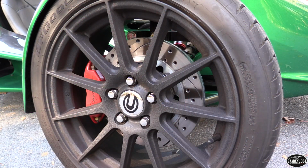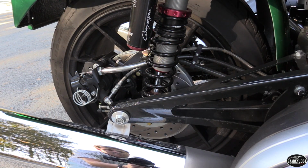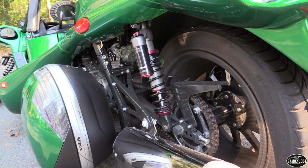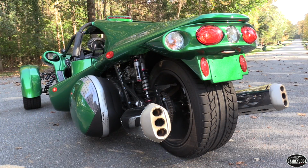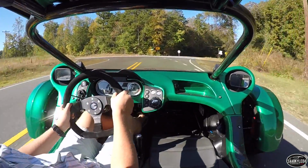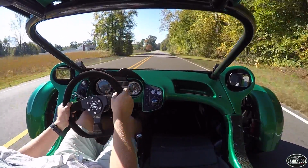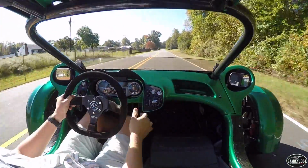The last major hardware upgrade for the performance model includes an upgraded braking system with internally ventilated, slotted and cross-drilled disc brakes and red calipers at each corner. The brakes aren't powered and there's no ABS or any form of electronic stability control. Stopping power is perfectly proportional to the pressure you apply. Like the steering, the brakes are communicative and easy to operate. It doesn't take much effort to stop even from higher speeds.